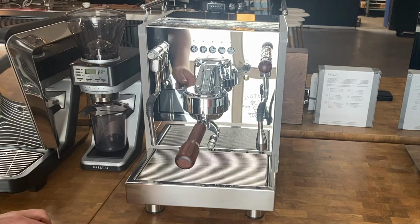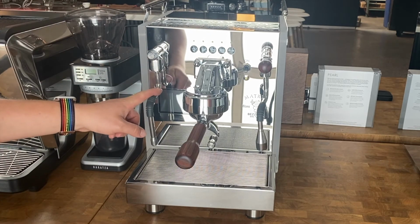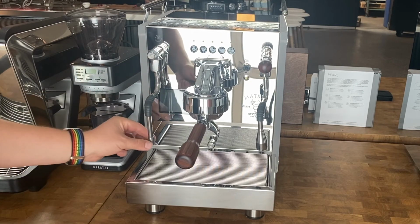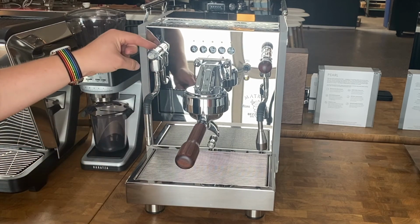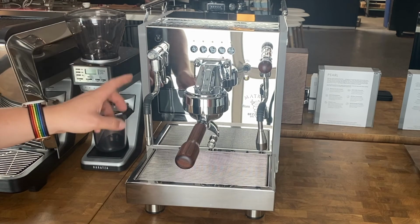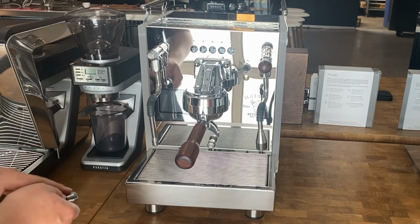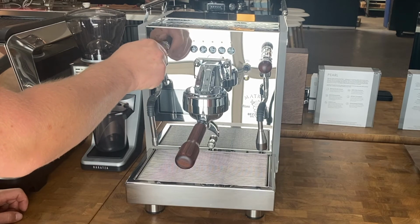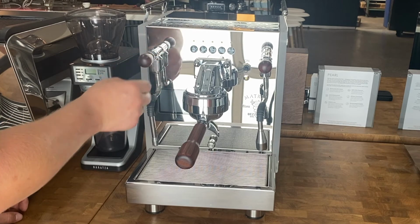Same testing procedures apply to these machines as it does the other one. Turn the machine back on with this removed. If the leak persists, that means the internal valve needs to be rebuilt. If the leak stops, it means that the adjustment was wrong, and you can begin to reinsert the joystick onto it until it's relatively stiff, but still has some play in it.